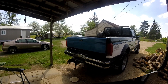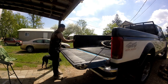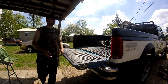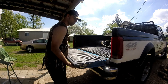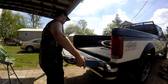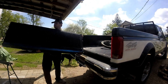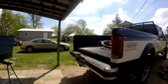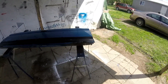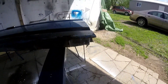So I'm going to take it off, set it on some stands, and start taking the grinder to it. Also the paint doesn't match - it's white with dark turquoise metallic paint, so that's what we're going to be doing. Now to get the tailgate off: take this little tab, pull it up, take the cable off, pull the side out, pull that side out - and there you go. Tailgate is off. As you can see, it is pretty rusty in here, going to need a nice little patch job for sure.